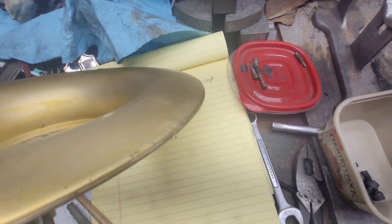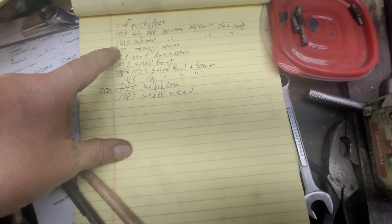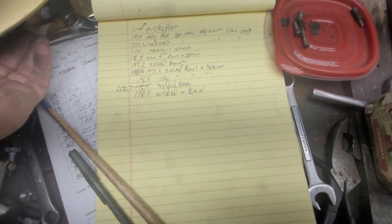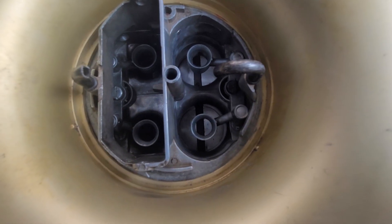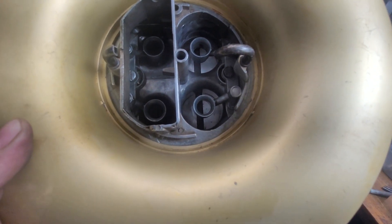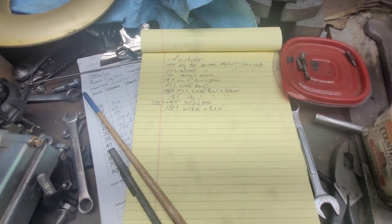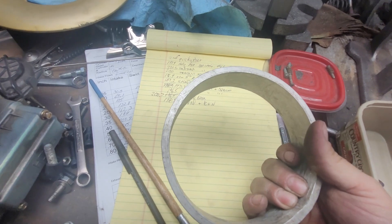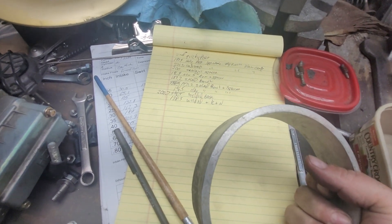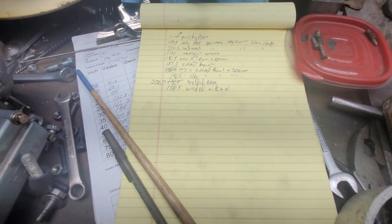The salad bowl looks like it should help really well — look at the nice radius it has for air to accelerate into the carb. It did alright, but it didn't do as well as the snubstack right on the carb. It's also a little bit bigger in diameter than the carb — it doesn't quite fit right. I don't know what it was originally designed for or how I got it. I kept it for no good reason, I guess, because I don't think I'll ever use it for anything but maybe some testing. Something simple like a spacer can make a difference — same idea as the spacer for the carb. It gives the air a chance to straighten out before it goes into the barrels.